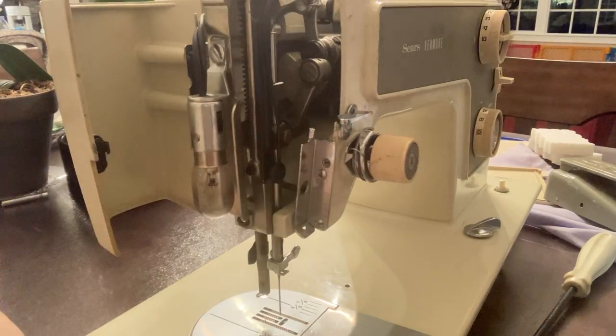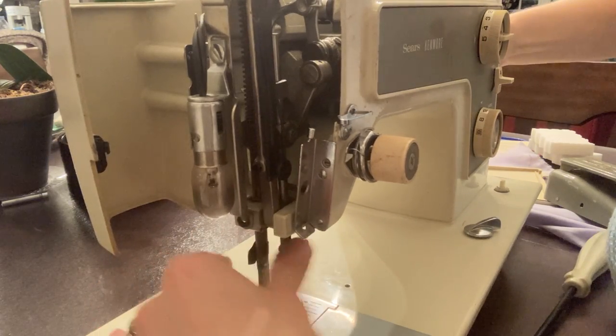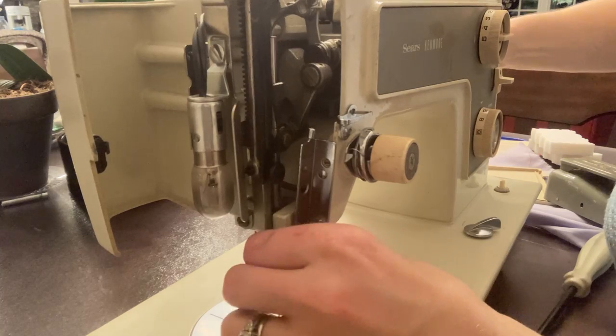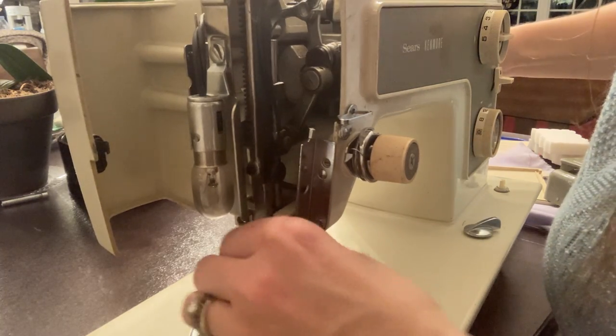Oil, oil, oil — and again in. That was so much easier! Did you see how much effort it took me the first time? You want to do that a couple times. Beautiful. And inside here, right there, there's a little plunger. It's supposed to move also with the arm and pop back out every time. So you want to oil this little plunger.